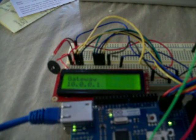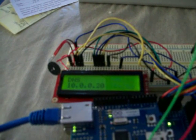You do host discovery, and what that would do is search your subnet as you had seen put in there. We have a port scanner, and we also have the ability to turn on and off the backlight. And I will just turn the backlight back on. The information that we have available to us is the IP address, the gateway, the DNS entries, subnet mask, MAC address, and whether or not the backlight is on.